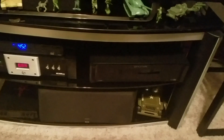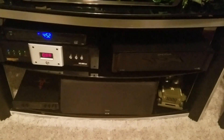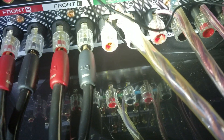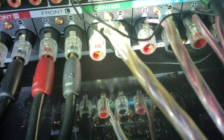The heart of any stereo system is going to be the front two channels. The next after that would be the center channel. It should be at ear listening level — ear height or eye level. In this case I can't do it because it won't fit on that second shelf. You're going to want to have that center channel as close to ear level as you can get it. I've already gone ahead and done this for you because it's too difficult to do holding the camera. One of the most important aspects is getting that phase correct — the positive and negative — getting those terminals in the correct ports. Tighten them down, not too hard, and it's going to make contact and you'll get an audio signal.